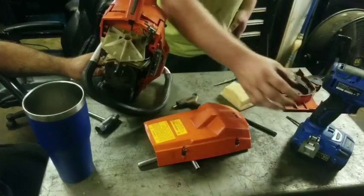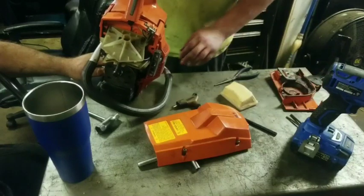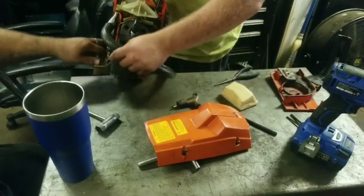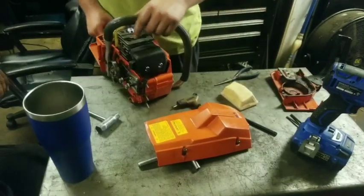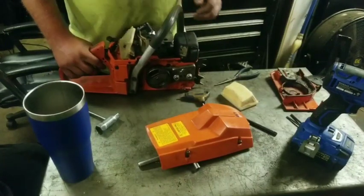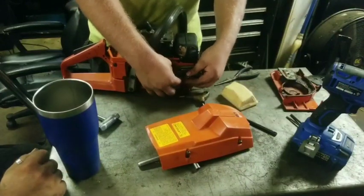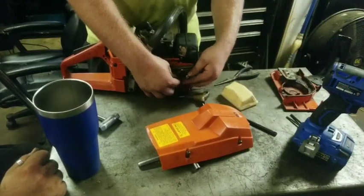For those of y'all wondering, that's a T25 Torx. It fits in the 4mm Allen. And when they get a little wear on them, it starts running around in circles inside of it. I mean, you can't readily go out and buy 4mm Allens that long, because they don't seem to have them for sale for whatever reason.